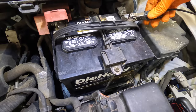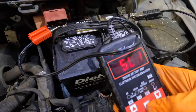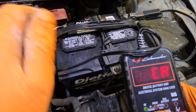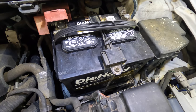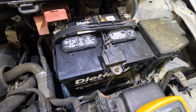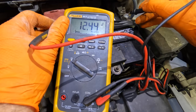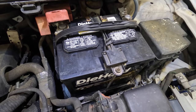Let's get the hold-down installed and then we can retest this bad alternator. In the interest of thoroughness, I'll go ahead and test this new battery too. This one's a 640 cranking amp - we have a capacity improvement. Maybe that'll make the alternator run. 718 - nice, good battery. Let's start it up. 12.44 volts - we have no charging system operation here. Still needs an alternator. Back to the well, shutting it down again.